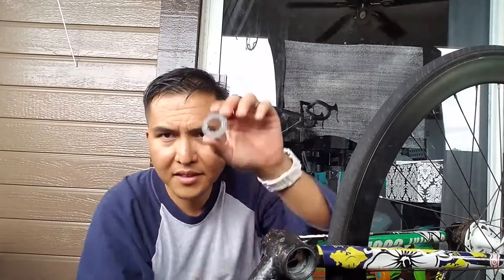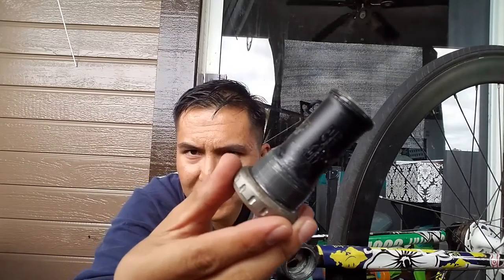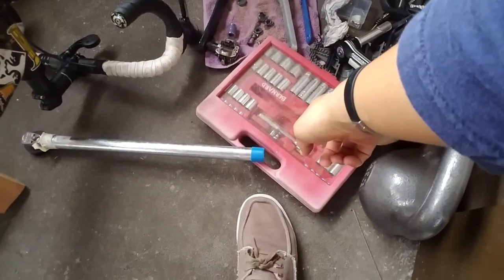There are also gasket covers on top of it. So that's GXP bottom bracket removal — it was stuck in the frame and I could not loosen it, but I loosened it using leverage with a galvanized pipe as my breaker bar. Hope that helps those of you who don't have a dedicated breaker bar, and just have a regular ratchet set. Thanks for watching!